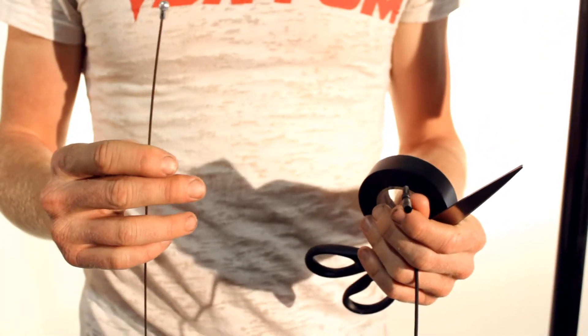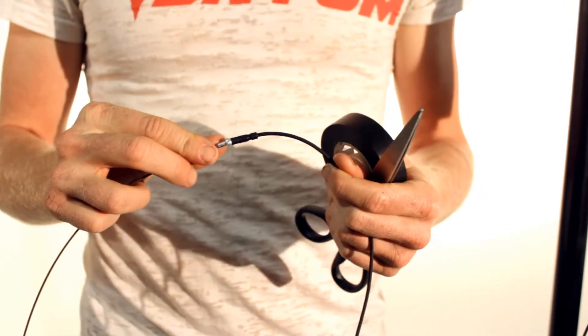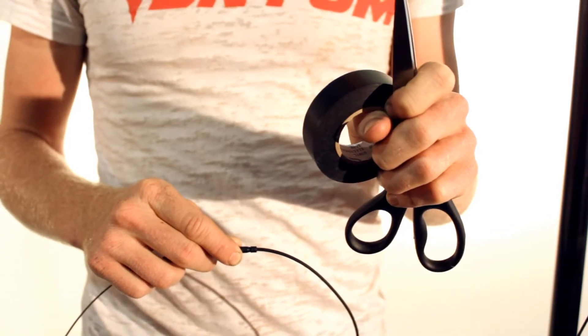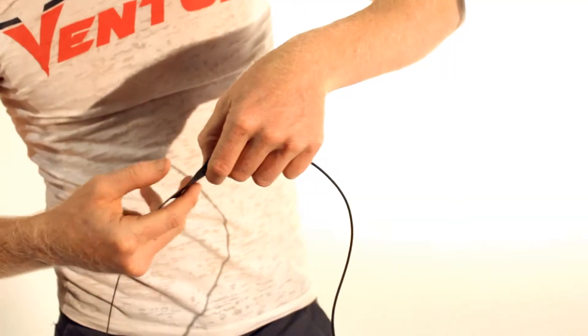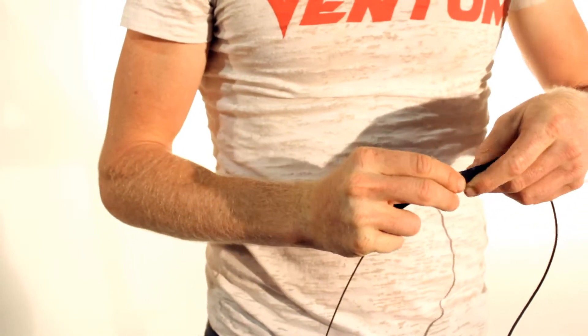Next, use an internal brake cable to insert the electrical cable into the bottom bracket. Use some electrical tape with a clean edge to join the two cables for installation. Tape the ends of the two cables together, keeping the overlap and the size of the joint small.